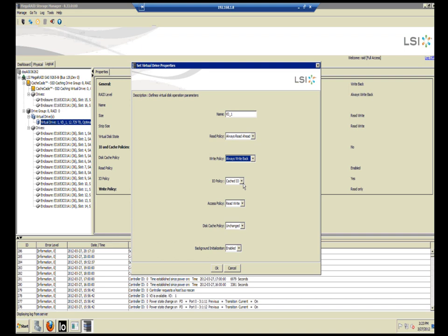Or you can say, I know that even if I have a BBU or cache vault and for some reason it's not working, I've got enough battery backup for the system that I feel safe to just do write back. We see a lot of things, not just with your product, but many products, that when the BBU, the battery backup unit, goes out, all of a sudden it goes into a write through state. Right, because it's a protection method. And if you don't, you can lose data. Yeah, so that's the reason.